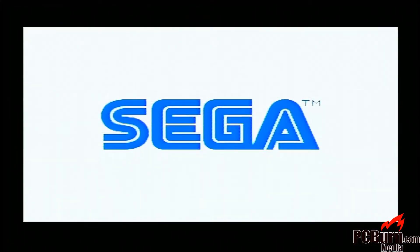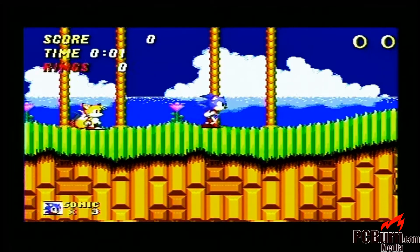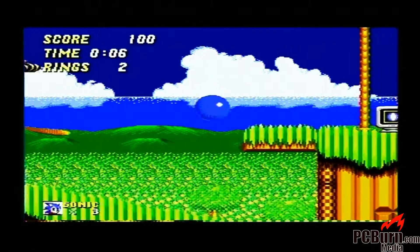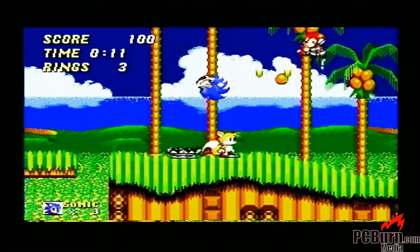So far so good — we're actually getting the correct entry screen and that sounds okay. Oh, that's not so good. It almost sounds like a PAL ROM on an NTSC system. Now, this is the cartridge, so I'm sure that's an NTSC ROM — so that's definitely an NTSC ROM possibly running on a PAL clock, which is all sorts of wrong.